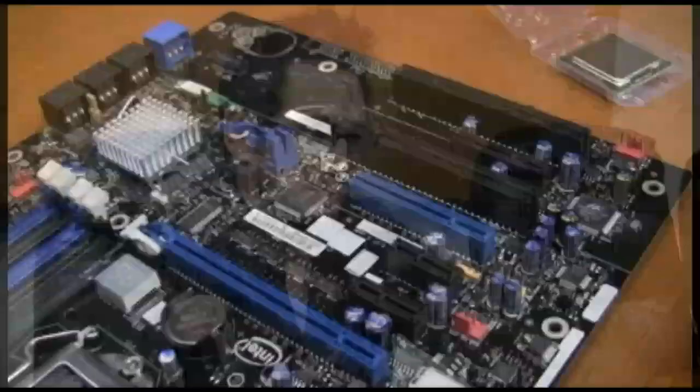What we have with the CPU is an integrated memory controller as well as graphic support, so your PCIe lanes are coming from the CPU. On the PCH side, that's going to take care of all your I/O functions, and we've also incorporated the clock buffers into the chipset as well. So that's all coming from here? Yep, exactly.